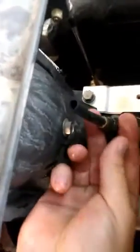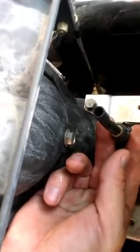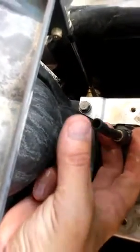If there's anybody that is going to have a sinking ski, right at the top, right here, this one actually is loose and pulls right out. But yeah, that goes inside the pump, and as the water is being pushed past this, it actually sucks water from the hull through here and ejects it out the jet drive, for anybody that doesn't know.